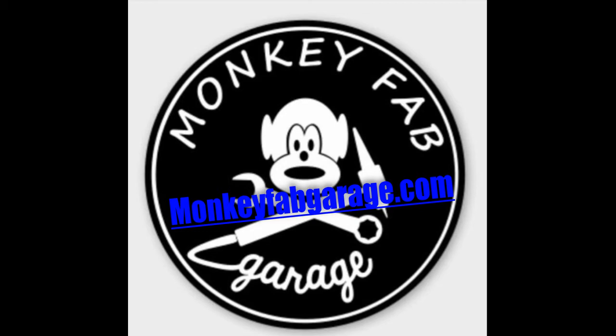When I did that, it welded really well, which is always, you know, it's welding mystery metal. You never really know what's going to happen. So I just basically used low amps, maybe 50, 60 amps, and just kind of pedaled it and just kind of melted it onto itself. And that worked really well. It actually sealed that up very well.